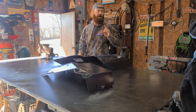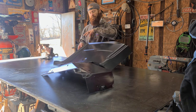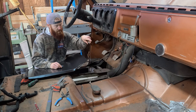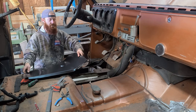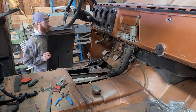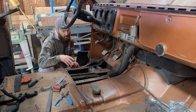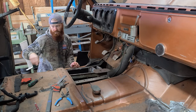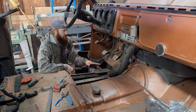Today we're going to be messing with that '72 C10 again. I've got some patch panels here — this is the full front floor pan pretty much from the seat board up to the firewall. In previous videos I went ahead and cut this floor out because it was very rough with a lot of rot. We've already put in new inner rockers and new cab supports everywhere around this thing, including rear cab supports. Now we're going to be addressing the floor.